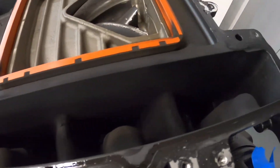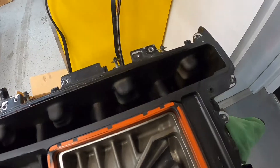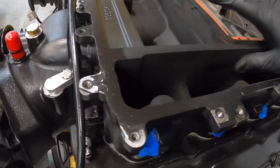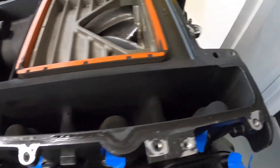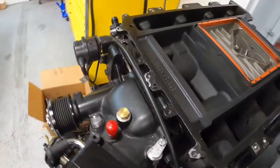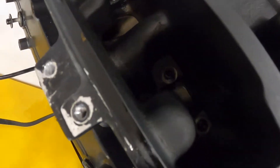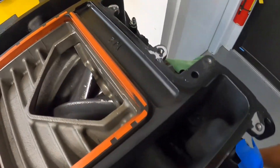There's a lot of built-up carbon in here. Let's see how black it is — I'm guessing that's not good. Got to see what's going on with that. Maybe that's what the injector guy was talking about. On the intake side, which is down there, it's still all black — still black soot. Got to clean that up.